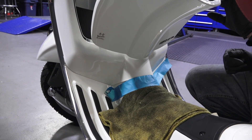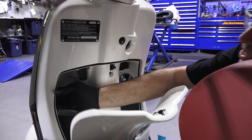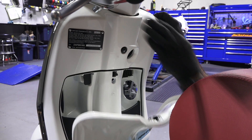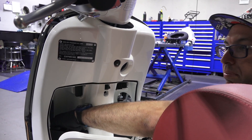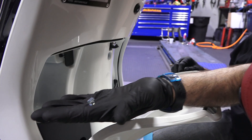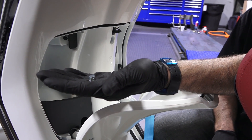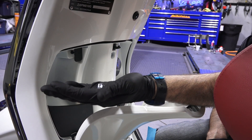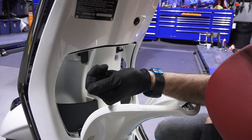Now here comes the fun part. All the screws are out but the glove box is on quite tight. I just put my hands in these holes and pull it straight out — there are six different clips, so pull straight out. You'll hear a little noise as those clips release. Before I even get the glove box fully off, here's what one of those clips looks like. There are six of them total. If you lose a clip in the frame it's not the end of the world — they don't cost much and we have them available.